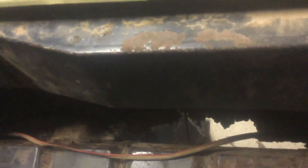But this part of rust cancer here, apart from what was in those two little bits of the K-Frame, is really it. By putting this on a rotisserie, I'm going to be able to get underneath it very, very easily, or turn it up on its side. Welding this is going to be a piece of cake, whereas welding upside down is nothing short of a nightmare.